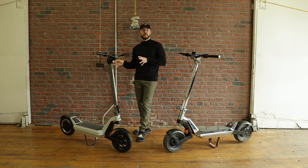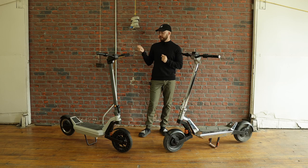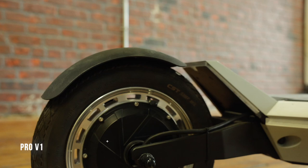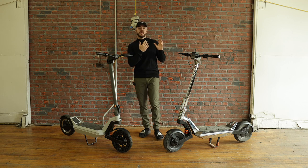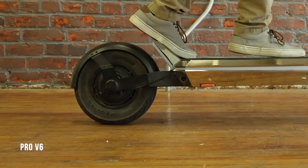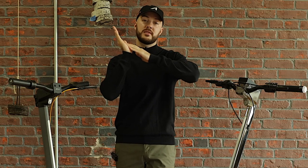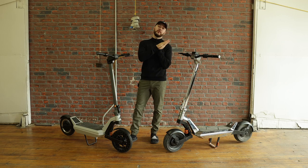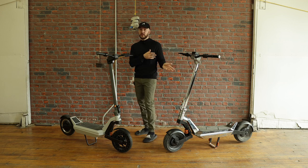The rear footrest on the V1 was way closer to the tire — it actually rubbed on it. At our Christmas party, two people were on the Pro and the tire was rubbing on the rear footrest, damaging the paint. From V2 all the way to V6, we added a rear suspension blocker, so even if the rubber block is completely removed, there is no way for the tire to touch the footrest. We also moved the footrest up, gaining suspension travel distance and closing the fender all the way back on the V6.